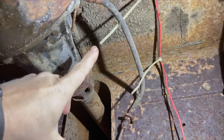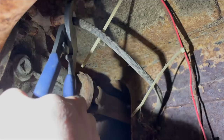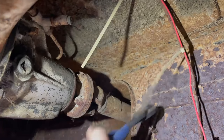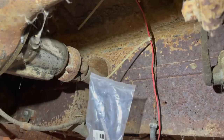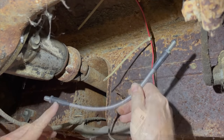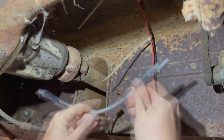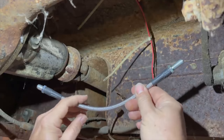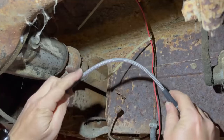This car has three brake hoses on it — one in the back and two in the front. I like to just cut the brake hoses so you can get a deep socket on them and spin them off easily. I'm going to replace all the brake hoses with stainless steel ones — I think these are Cobalt brand. One thing I like about these hoses is the ends are just the same as the original hoses. They do not come with new fasteners, so you'll have to use your nuts and washers off the original hoses, but otherwise these install exactly the same as the originals, just in better quality stainless steel.